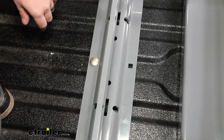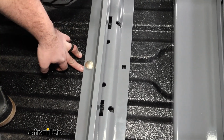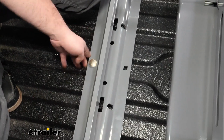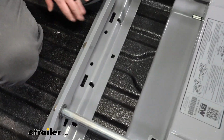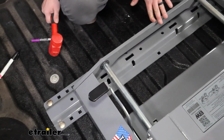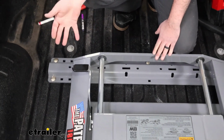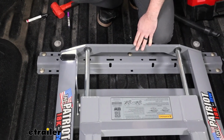Now, just as before, we're following essentially the same thing. Because we have that drop-down corrugation on this center bolt, make sure you put the U-shaped spacer. And with these, sometimes, as I mentioned, that powder coat, just take a dead blow, knock those down, because you're going to want all of those threads to be able to get that hardware started. It's going to make it a lot easier than having to jump back up here to do that. Speaking of, I've knocked those down.